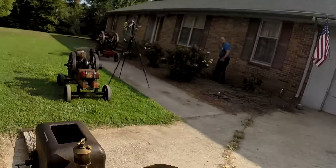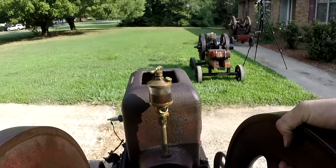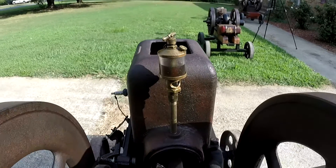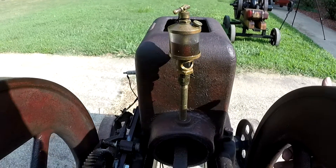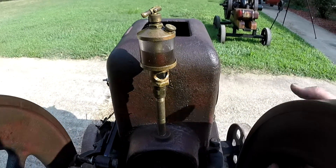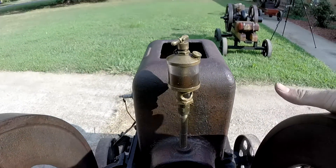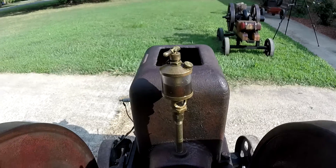When I'm talking about the four-stroke cycle, it's basically intake, compression, power, and exhaust. Right now this motor is going up on the compression stroke, so when it gets to the top, that's when the spark plug fires and sends the piston back with all its force — that's your power stroke. Then when the piston comes back around it pushes all the gases from the explosion out through the exhaust valve. When it's done with that, the piston coming back in creates a vacuum inside the cylinder, pulling air and gas in, just for it to hit the compression stroke again.